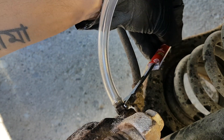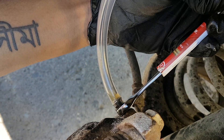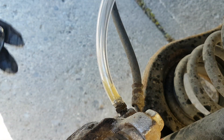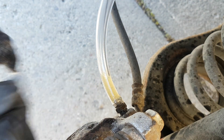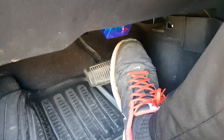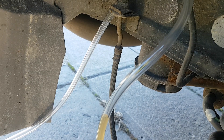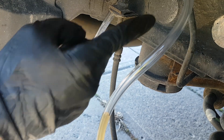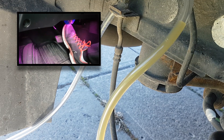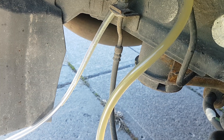Here's the valve and here's our 10 millimeter wrench — we're going to put this on and open it. As you can see, there's already some liquid coming out, and you can see an air bubble right there, which is really good. The next step is to get into your car and press on the brakes only halfway through, about eight to nine times. You're going to see the fluid rise up and go all the way down. We'll keep doing this until the murky looking color becomes as clear as possible.